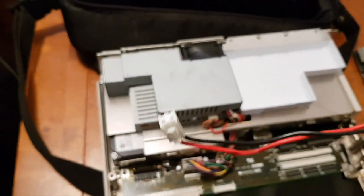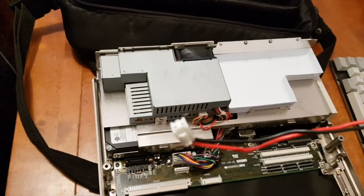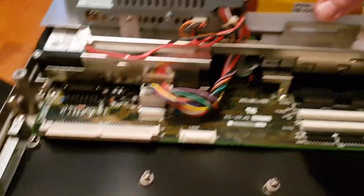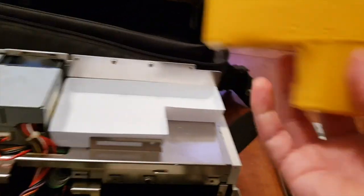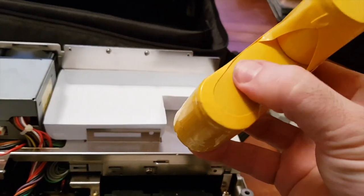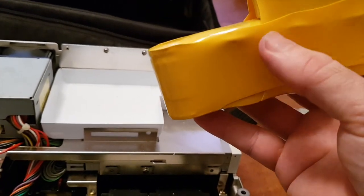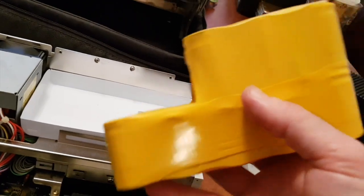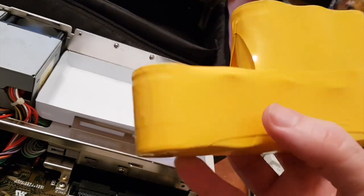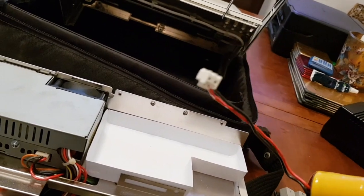Normally, you would see some corrosion, some telltale green gunk around the end of the power connector, but not in this case. So this is quite a simple shrink-wrapped battery with D cells, or they might be sub-D. Bit like with the T1000 where we had sub C. So that's 1, 2, 3, 4, 5, 6, 7, 8 cells, probably in series, given that you've just got one output.